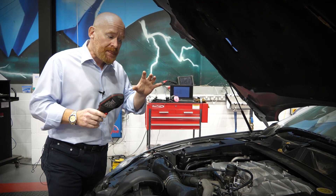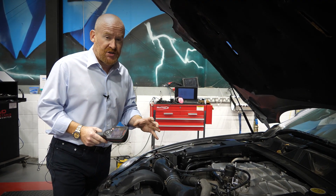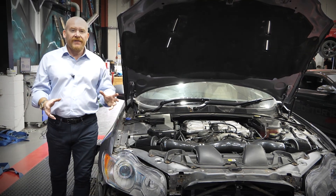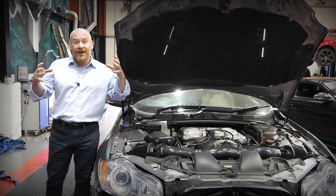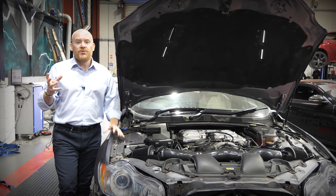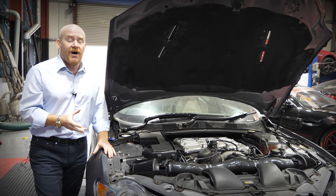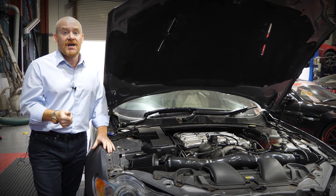This is a permanent arrangement — this coolant is going to be running at this temperature all the time, which means we can now crank up the spark advance, fuel pressure, and tuning to take advantage of the super cold supercharger producing maximum power with no risk of pinking or detonation. Next we want to be fitting the new TVS2300 supercharger to this car — we're going to be talking way over 700 brake horsepower. To achieve that type of power we need this level of cooling. Along with our stage three tuning, upper and lower pulleys, air induction system, supercharger coolant pump, larger radiator, and now the supercharger chiller kit, we're going to have some real fun. At the moment we're running at about 665 brake horsepower — we're going to push past the 700 barrier.